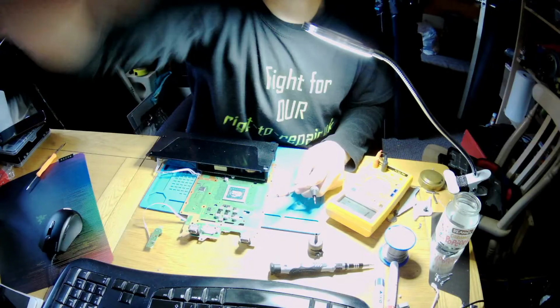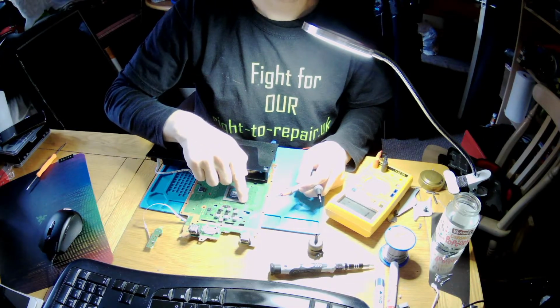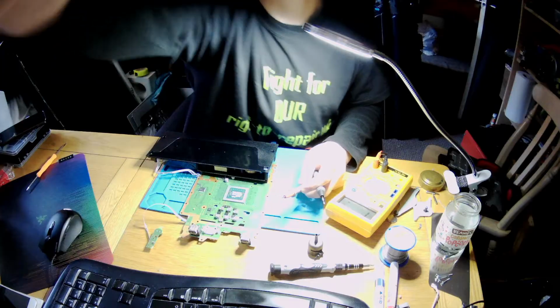Oh, sorry, you haven't seen it. Yes, by this capacitor here, on the side of APU, there is a small one. On one side it's no short, on the second it's a bit, because of course. And we've checked that there's no 5 volts on those USB ports when I'm plugging in my USB meter, okay? And the rest we will see in the next episode.